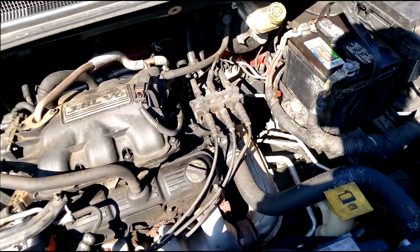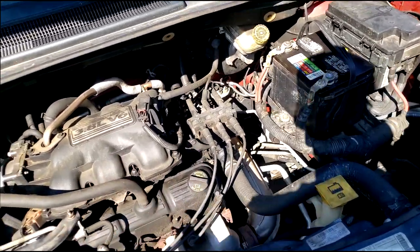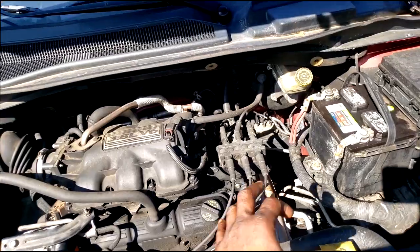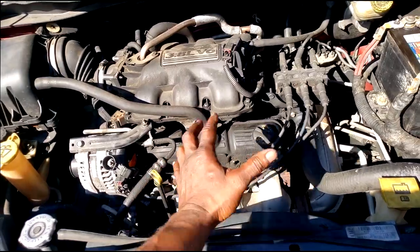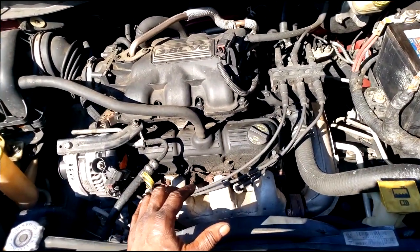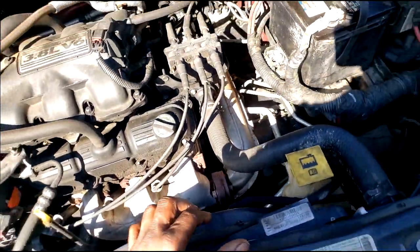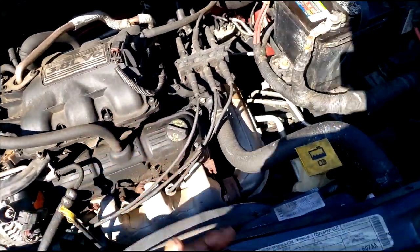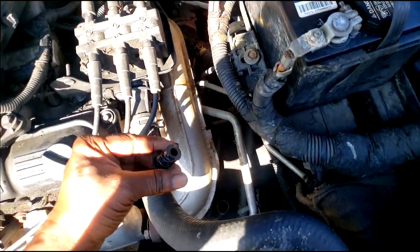Oh, guys, y'all know the old traditional way of checking out a transmission. First thing you really want to do is verify the fluid. However, you guessed it, guys, no dipstick. Now, the unique thing about this one, it's a 62TE, by the way, a 6-speed automatic transmission. The unique thing about this one and all 62TEs, they at least gave you a dipstick tube. So yes, with a dipstick tube you can check the fluid. You personally, on the other hand, will have to get a dipstick. The car doesn't come equipped with a dipstick, but I am in a dire situation right now.